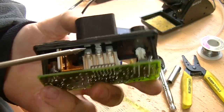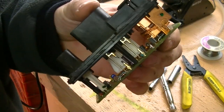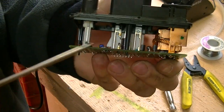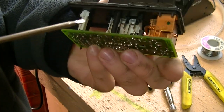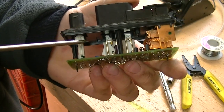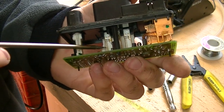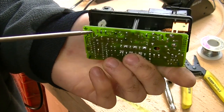And here are three of the fusible links, and here are the other three. As you can see, this one here has burned out. The reason there's two sides to each of these, as far as I'm aware, is one of them feeds the computer to tell it there's power going to that glow plug, and one is the feed that goes to the glow plug itself.